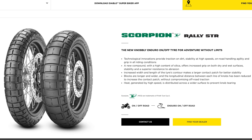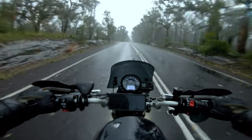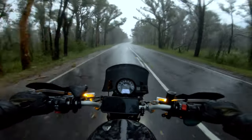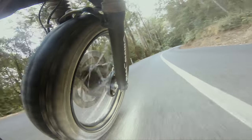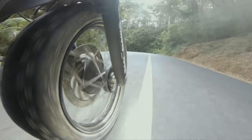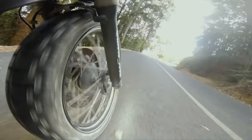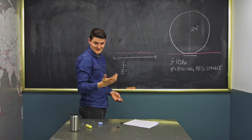Two: a new compound with high silica content offers increased grip on both dry and wet surfaces, stability and superior resistance to abrasion. The silica dispels water away from the tyre so you have better traction in the wet, which is incredible. It allows for a wider operating temperature range — you can ride down to 7 degrees Celsius and still have a very good performing tyre, rather than 14 degrees without it. So if you're in a cooler climate, these will still perform really well.